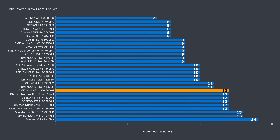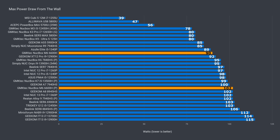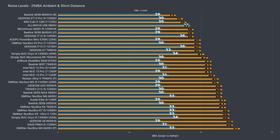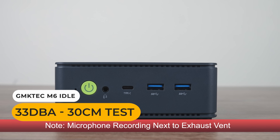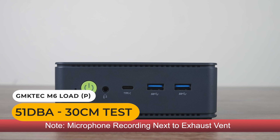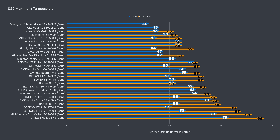If you were thinking the 6600H would come back with lower power draw numbers, it doesn't — at least not in this mini. Idle power draw is on the higher side, and the maximum depends on your power mode, but it's around what the top CPUs come back with. That much heat is taxing on the cooling. The M6 held up decently in balanced mode, but it did thermal throttle quite a bit in performance mode under full core load. It's likely this mini isn't going to be quiet — it's definitely audible at idle, and load fan noise depends on the performance profile set in the BIOS. The included NVMe drive doesn't have a thermal sensor on the controller, but 58°C for the drive is a decent result given it has a heatsink and fan.